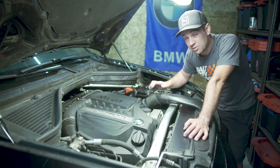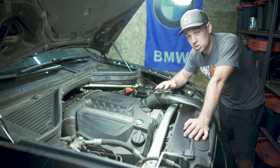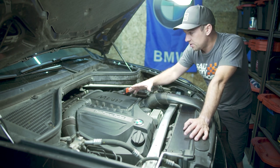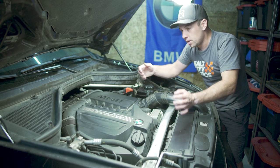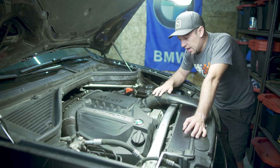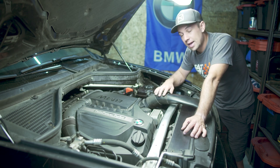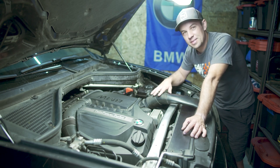I had a previous video on the N52 where I was able to get that bolt out without disconnecting the intake manifold. However, on the N54 and N55, to my knowledge, this is not possible - I've seen people claim that it's possible but I've never actually seen anybody do it. That being said, once we have the intake manifold to a point where we can very carefully pull it up, we're going to be able to pull out that last E10 Torx, and at that point we should be able to clean everything up, replace our gasket, and go in reverse order and be done with the job. Theory is always fun and easy - let's see how this turns out.